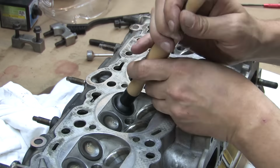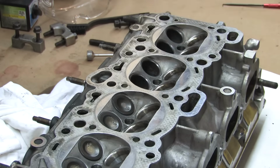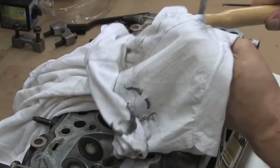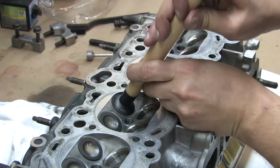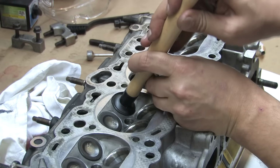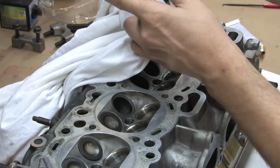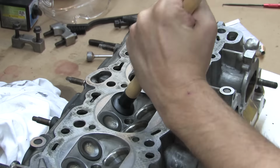See what I mean about love-hate? If you're not installing polished valves, this thing can be a real pain in the ass. Don't lose your patience and break out the drill because of this. If you've never done a valve job, it's important to do it this way the first time and get a feel for it. The result you achieve doing this manually will give you a good idea of what to look for, what a lapped valve sounds like, and what it feels like.